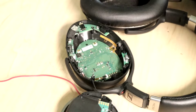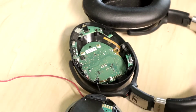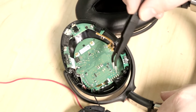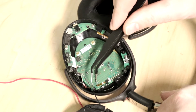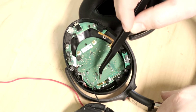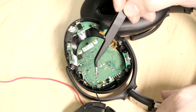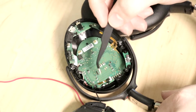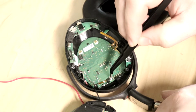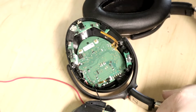Alright everybody, so I've been poking around a little bit off video when I was getting a new battery, just to try to familiarize myself with which pieces do what, so I knew what I was messing with. My understanding, after looking at this and watching a video as well, is that this ribbon cable comes in and clips into the board here. This is the sensor wire that hooks up to the magnetic switch. People usually disconnect it, and I saw one video where somebody shoved some wires in the first 2 pins here. So I'm assuming it's the first 2 pins that actually connect the magnetic sensor.